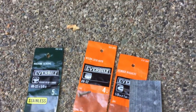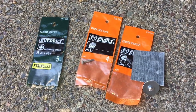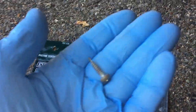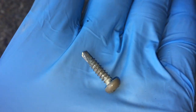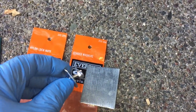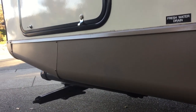I hope this helps everybody. Make sure you take a look under your trailer and keep a watch in your mirrors for what's going on behind you. Here's the screws they used to hold under here in place — they just work their way out. I recommend changing them out. I just did it on the bottoms, not on the sides, because they seem to be in place pretty good and they have caulking under them so they don't move around.